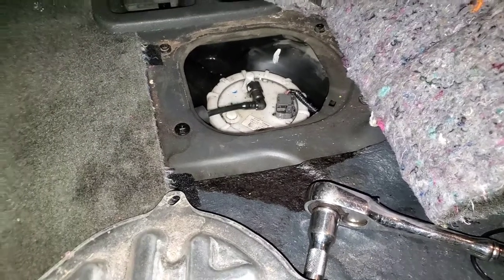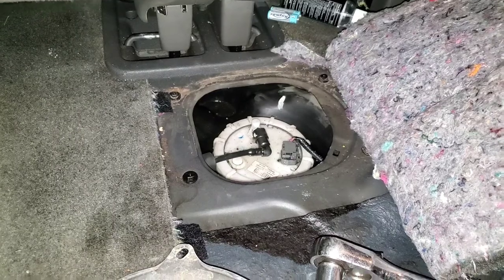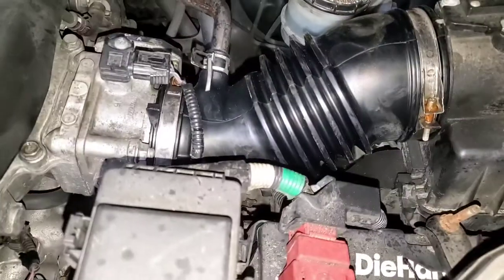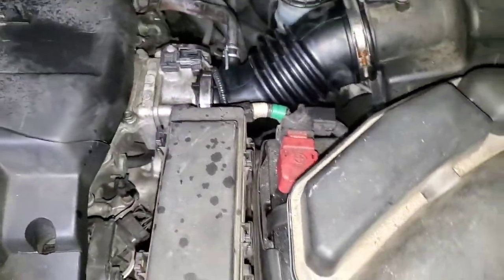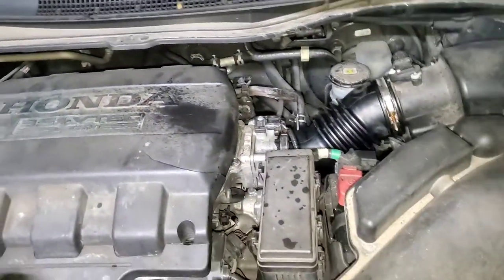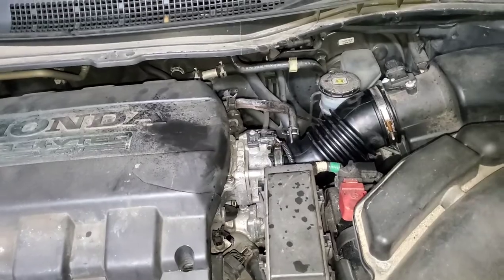A shout-out to Pine Hollow Auto Diagnostics. The intake tube we referenced earlier — I've swapped that out; it just took two band clamps, 5.5mm hex heads, a quick hose clamp swap. That was causing the lean condition. The fuel gauge is now working as you've seen. I'm parking it outside because of the fumes and it's cold. Now we just wait for the catalytic converter to come in. We're done for tonight — see you guys later.